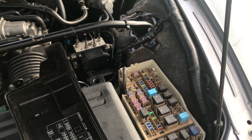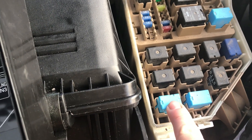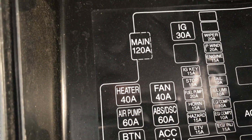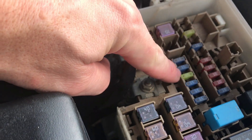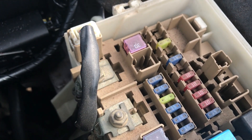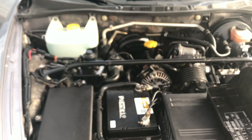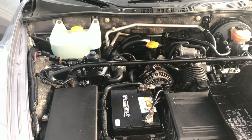To remove the fuel pump relay and fuse: looking at your diagram, the fuel pump relay is right down here. The fuel pump fuse is the third one down and it's a 20-amp fuse — count one, two, three, and it's a different color. Go ahead and pull that fuse, then pull the relay. I'll show you the next step, which is hooking up the hose to your vacuum lines.